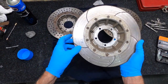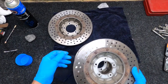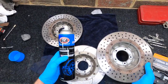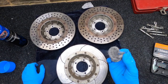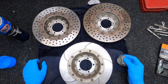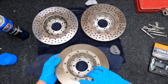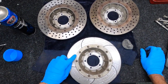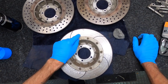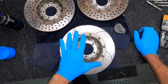We're gonna try and give them a bit of a refurb. The rear is not in too bad a shape - it's got some smudging and wear marks. The fronts are pretty rusty, but I'm thinking I'll firstly hit them with a bit of brake parts cleaner, give them a spray, hit them with steel wool, and then maybe run a bit of 600 wet and dry paper over them as well to bring them up. Once the disc is nice and clean I'll mask around the edge where the pad doesn't wear.